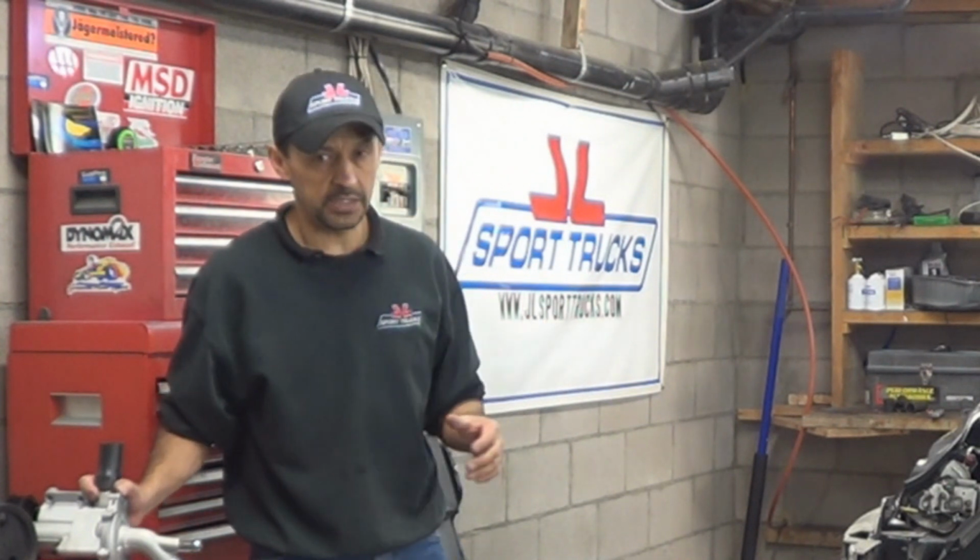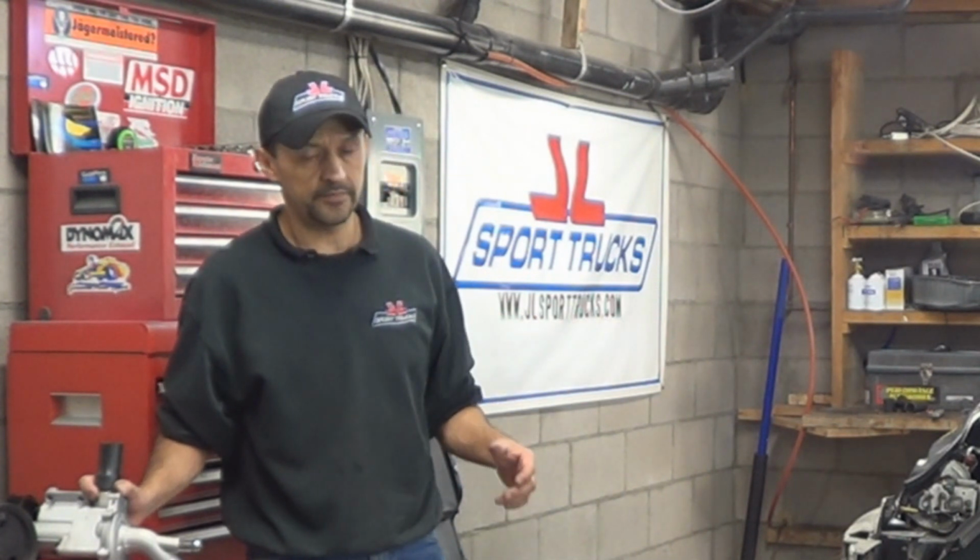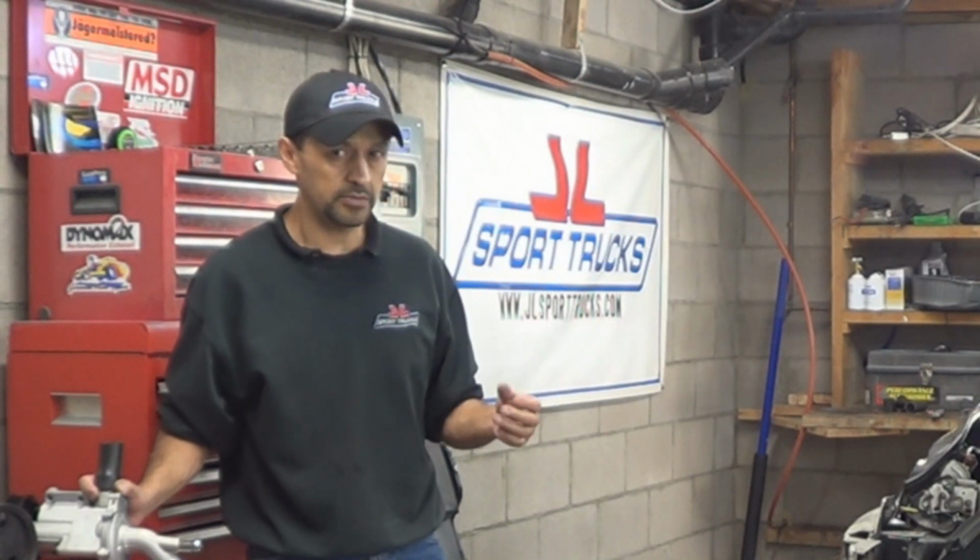Let it cool down for a couple minutes. Bleed the air off again. And just do it all over until you don't have any air and you can just leave it running and it doesn't go past half. The reason why you're going to have air is because when you drain the coolant, air enters the system. So it has to exit. And when there's air, the thermostat doesn't open correctly. So that's why you got to keep doing it this way until the air is gone and the thermostat starts working.